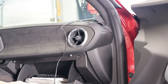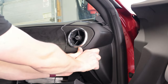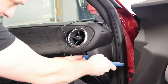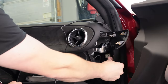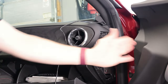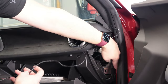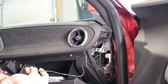Now that we've got it near the dash, pop the side panel off by opening the glove box and getting your fingers in between the glove box and the panel, then pushing out towards the door. The first time you do this it'll be really difficult, so I recommend a panel tool. Once you've done it a few times it'll pop right off — just a few push clips hold it in place. Set that down out of the way and you have access to route the wire down into the passenger side floorboard.